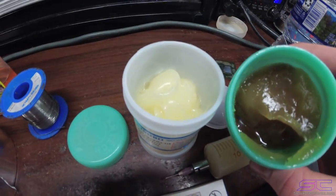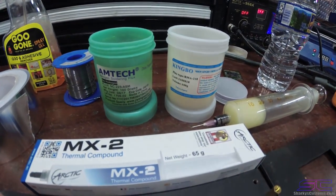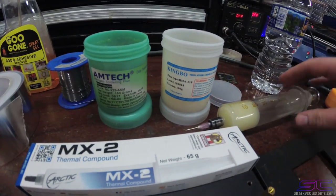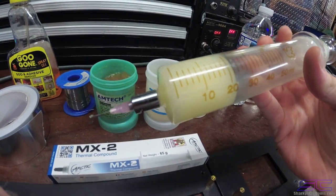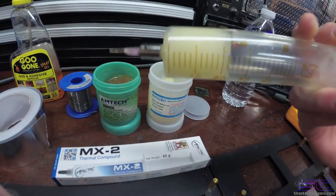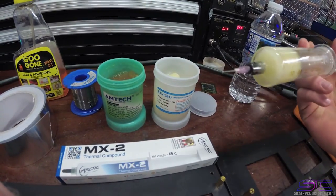the color is totally different, and this does have a smell to it. So I know you can get both of them for pretty cheap online, and I'll have links to these in the description as well. I would also recommend getting some type of syringe, because you'll be needing to pretty much inject the flux under the GPU to do the reflow.